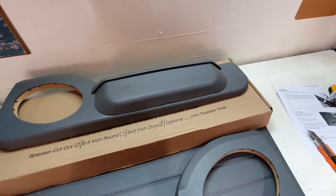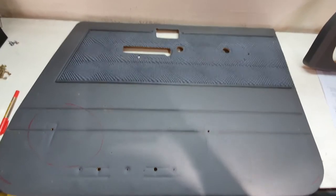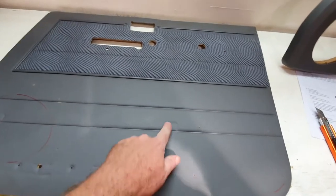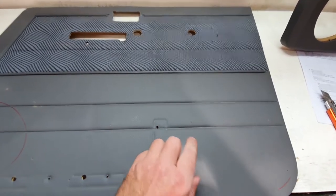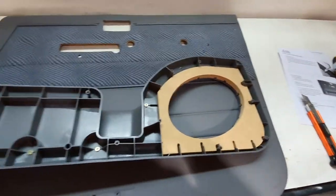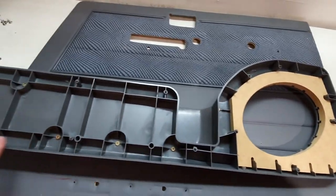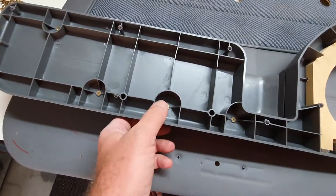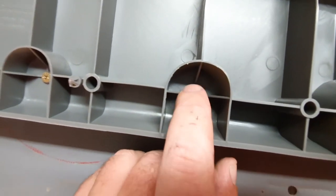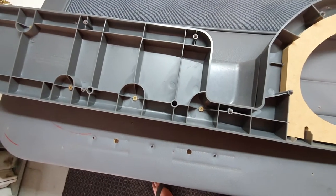So we'll show you what we're actually going to do to fit them. You remove your old map pocket, then get the actual console part. You fit your factory pocket to it using their screws, and they sit in very nicely. The plastic pulls them quite firmly around the screw, so I think that even on some pretty heavy corrugation it won't come out.